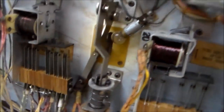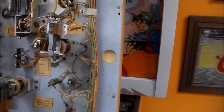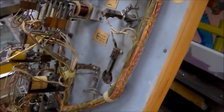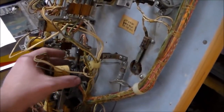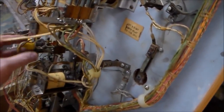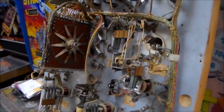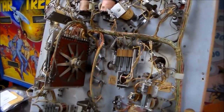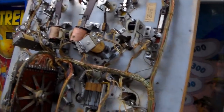We'll go through and clean all those switches and make sure they're all adjusted fairly decent. Then we'll clean the few relays that are on the bottom — I see four, five relays. Then we'll clean the switches on the pop bumpers. Same thing. And if I find any problems I'll come back. I'm also going to take this apart, so I'll show you how those come apart, since that's a good one we can get to really easily and it'll make for a good video.